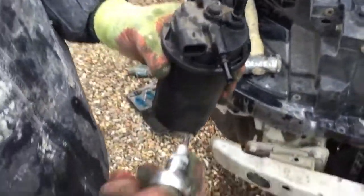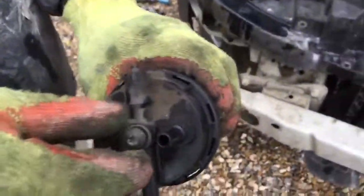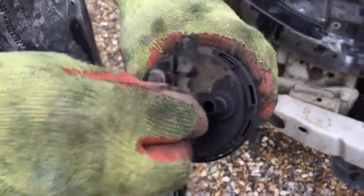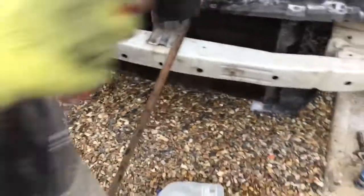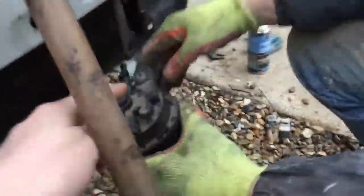There's a Torx at the top and that is T30 - Torx 30. Undo that - already undone. It did drain a bit. What you can do is use a milk bottle because if you undo this bit here, it just drains all the fuel via that drain valve.